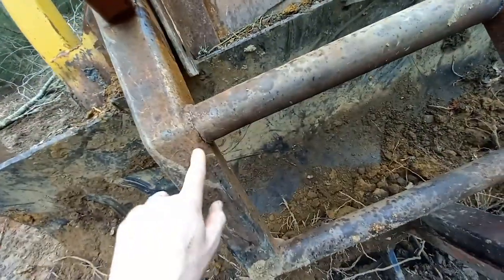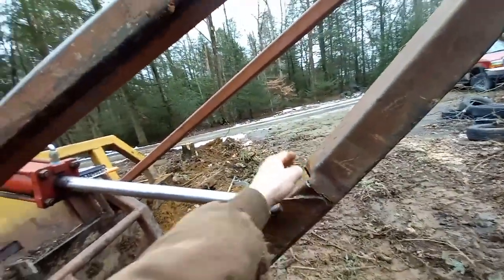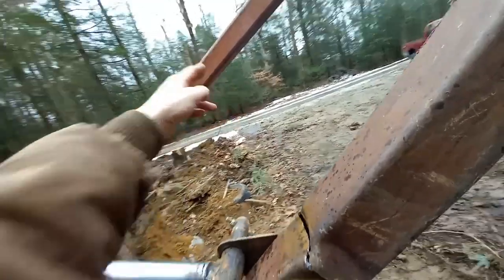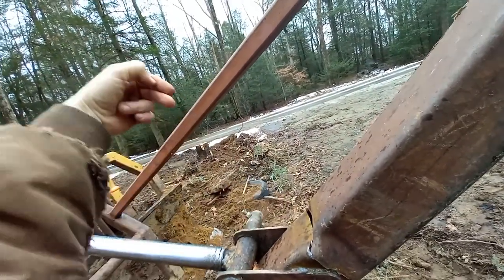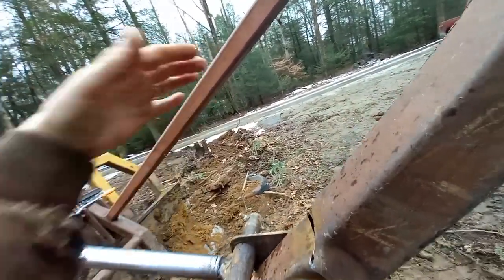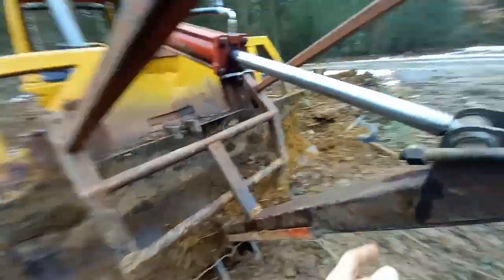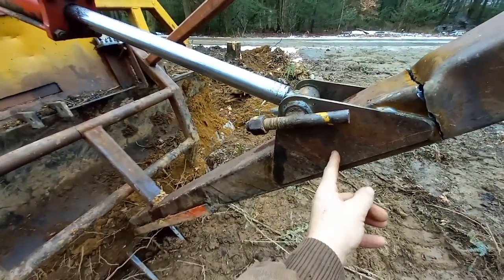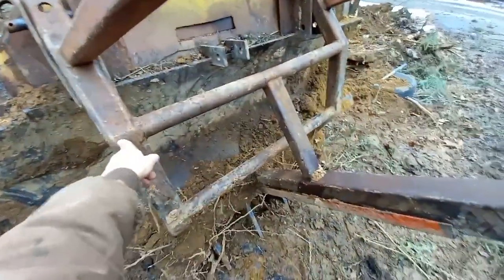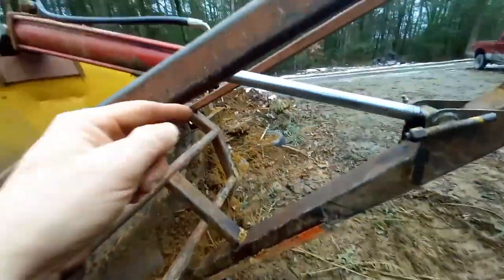I got this tube here from the flex. This thing here is just about snapped through, so I got a brace right there. And I'm gonna be adding in a triangular 1, 2, 3, and maybe even a 4, maybe even a tube straight down. But definitely a brace from here to here, and then another brace across so that these can't spread. I don't know if it'll be a single triangle or a bisected triangle, depends. And then from here, that's my dang kid. From here to here, and then maybe a gusset in this dimension. Possibly one down to here.